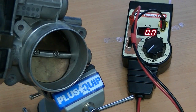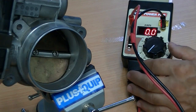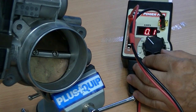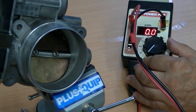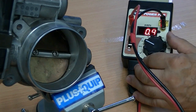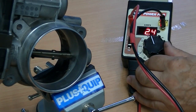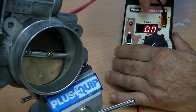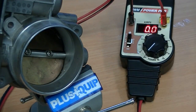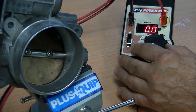The tool connection procedure is similar to the EGR valve tested earlier. We can now move the dial and operate the throttle valve to a fully open position, and monitor any binding or interruptions to the movement and the current flow during operation. By reversing the motor polarity wiring, the throttle valve should move to a fully closed position when the dial is moved to an increased duty cycle percentage.